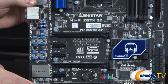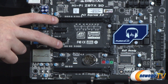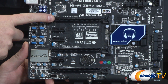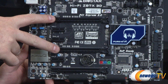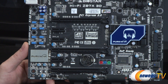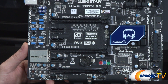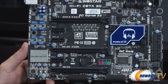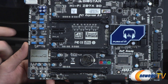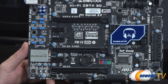Let's talk about PCI Express. All your PCI Express slots are located right here. You have a couple that run at PCI Express Gen 3 — the top slot and this slot right here — both full-length X16 PCI Express slots. With a single card at the top it runs at X16; with two cards it runs at X8 and X8. This board should be compatible with both two-way Crossfire X and two-way NVIDIA SLI solutions. Crossfire X is definitely documented as supported. I haven't seen SLI specifically listed, so double-check with Biostar if you're planning a two-card NVIDIA configuration.